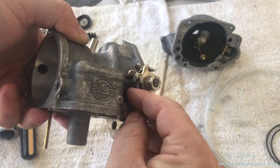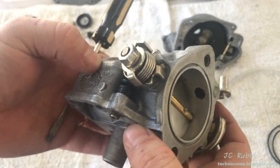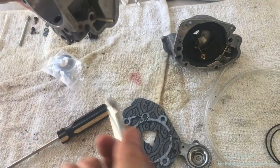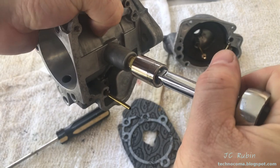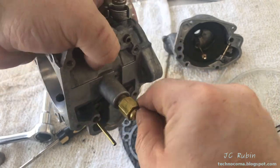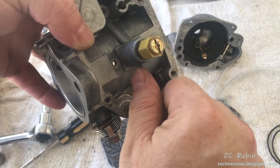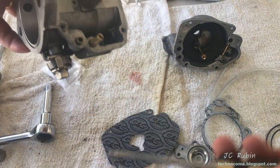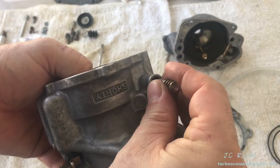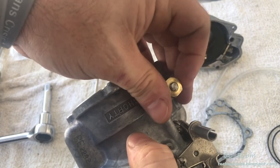This was the old torn dust cap for the accelerator pump — here's a new one from the kit. I'm going to put that in right over here; this snaps over that brass fitting and you just have to work it over and push it into position with the screwdriver. I'm going to screw this emulsion tube back in — just give it a little tighten, just to seat it. Then the jet — give it a little turn to make sure it's tight, just a little tighten. I'll put this jet back in with a screwdriver, give it a little tighten. On the top side I'll put this enrichener down here with the spring, followed by its cover — make sure the spring doesn't bind and start turning it by hand all the way to full seat.